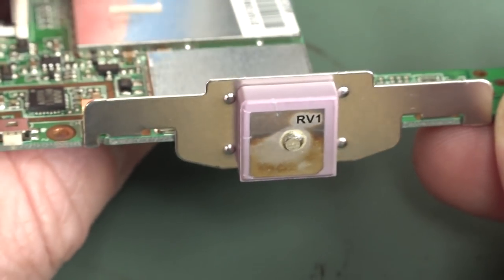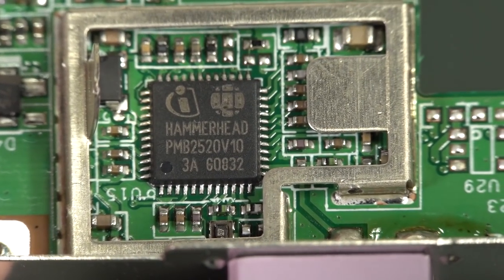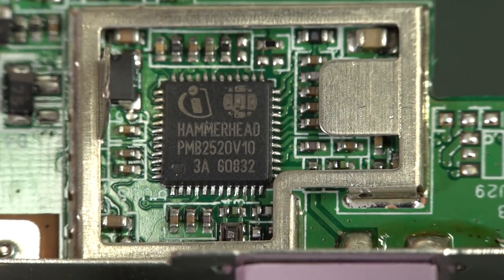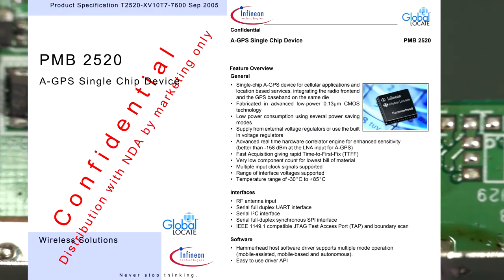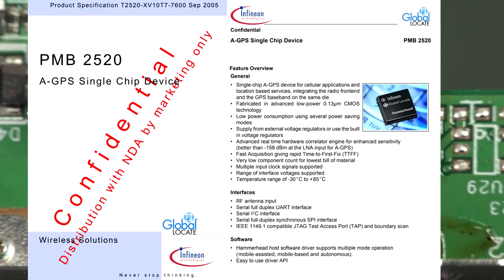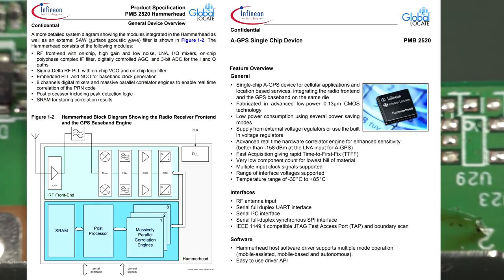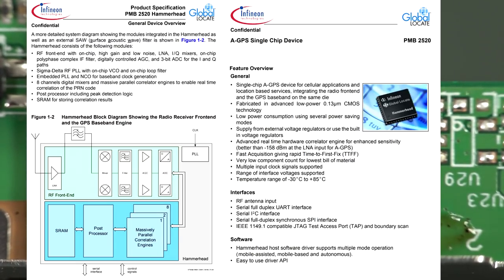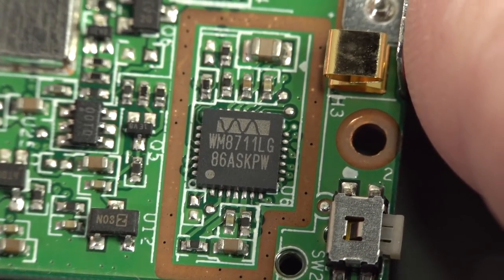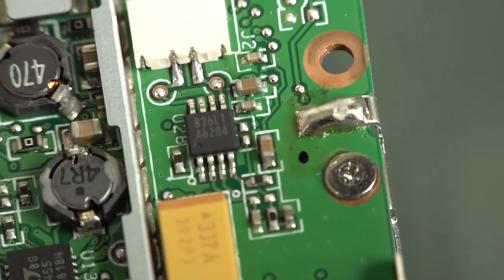You've got all your passives on the back, a whole bunch of termination resistors, all your bypass caps. There's a chip on there — you can see all the vias coming through — that's probably the large processor. We can pop these cans off too. Under that can, that's all our power supply jobbies — you've got the inductors and a whole bunch of passives. And on the top we've just got a little patch antenna. Right next to the patch antenna — surprise — is our GPS receiver.